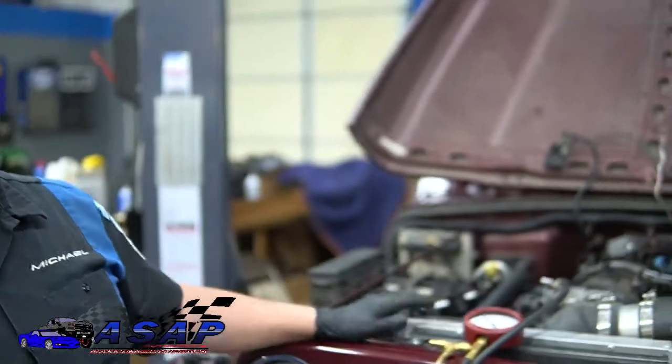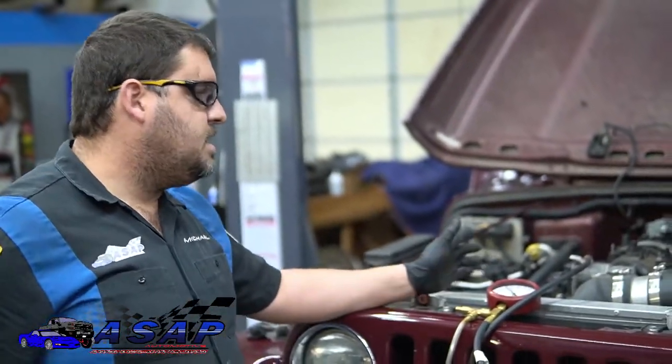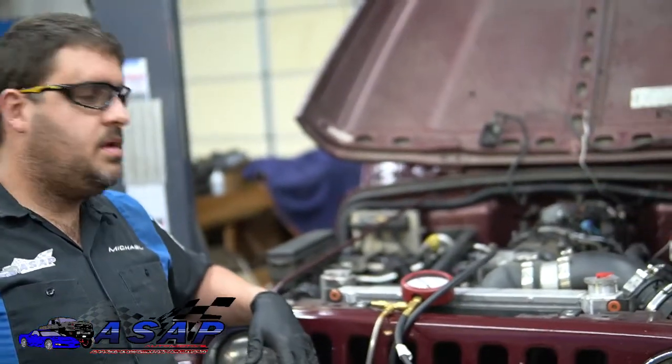So we can go back to the dyno now, see what she does, and hopefully make a little bit more power and not lean out so bad. The 255 is a good safe bet. It's just a good all-around pump. You know, it's not too much. You get up past like a 340 or some stuff like that, you really got to start making some upgrades. This 255, we're still able to run this, stock lines and stuff that we got, and we should be good. We're running stock injectors in this thing and all, so it should put us right about where we'll be.